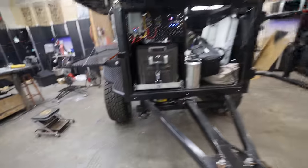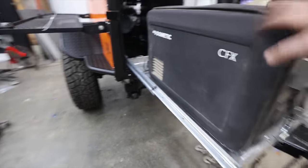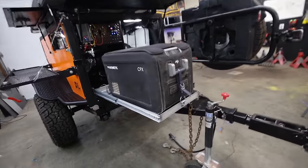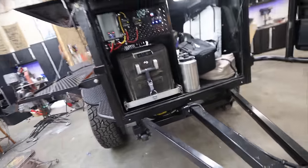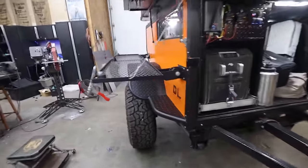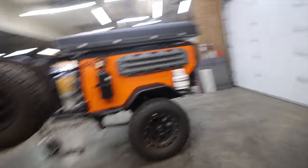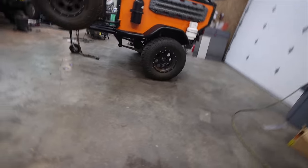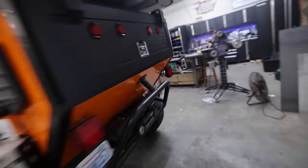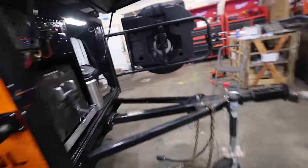Ready or not, this trailer is going to Montana in like seven hours and I had to rush to finish this slide. These are 500-pound-rated slides I got from Amazon — I went heavy because if I'm using a tow vehicle that already has a fridge in it, I could put a whole bunch of water in here and still want it to slide in and out easily. I need to put some sort of latch to keep it from coming out while driving, but we're out of time — I've got to get to Montana. I also ended up putting the heavy-duty springs in, so it's a little taller and can take more weight. My gut feeling was correct that once we got the tent, accessories, and a full load on, we'd need heavier springs.